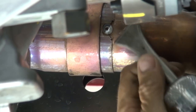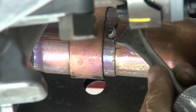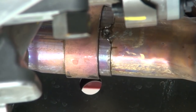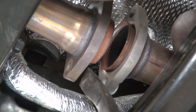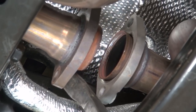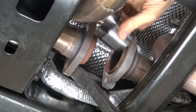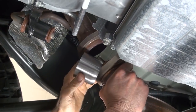If your Jeep has been on the road a while, it's worth hitting that clamp and bolt with some penetrating oil. We'll need to slide the intermediate pipe deeper into the Y pipe for muffler clearance. Use a chisel or hammer to remove the indexing stop. Using a pry bar, spread the crossover pipe wide enough to slide in the exhaust spacers. The intermediate pipe should slide into the Y pipe about half to three-quarters of an inch. If not, use a dead blow hammer and tap on the backside of the muffler to slide it forward.